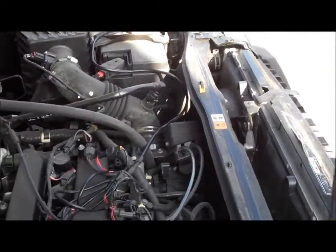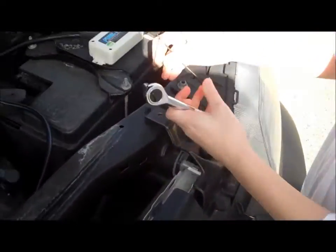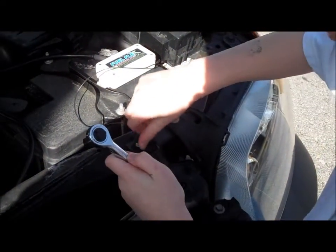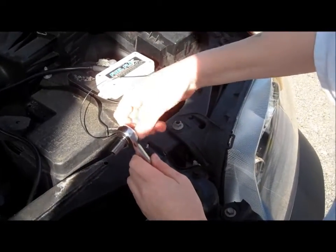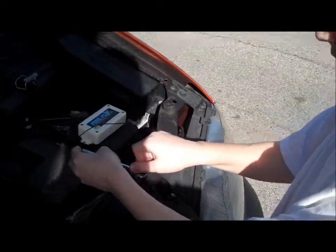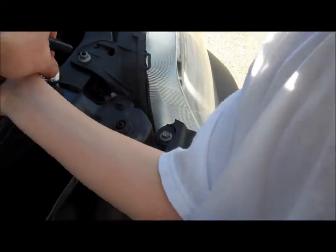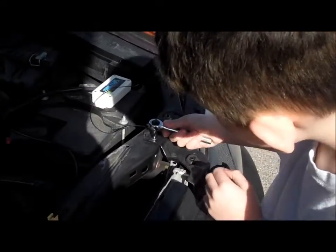Okay, and what's the last thing you have to do now? You got the wires out — you want to make sure they're not touching anything, right? Right. You could use wire ties, but we won't do that right now. Okay, looks like you found a good ground there — to the chassis, bolt. And so that's an important part, right? Making sure the ground is on. I'm not really good with this. Well, you're doing a fantastic job Jack.